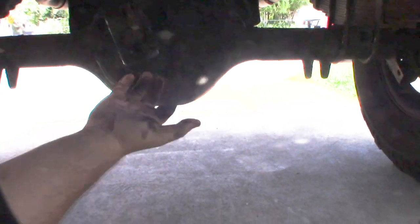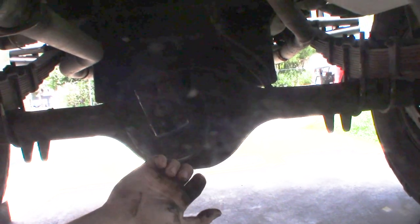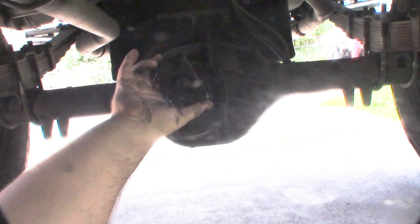You have to be really careful here - this nut sets the preload on the bearings. This is what pulls the bearing against the bearing race, so if you over-tighten it you're going to create a lot of friction on the bearings. I tightened it just a tiny bit and got rid of the play, but that doesn't mean the splines are worn out. Do not over-tighten this - the bearings will wear themselves in and eventually this will become loose again. Over-tightening will actually generate a lot of heat in there.